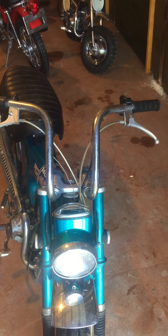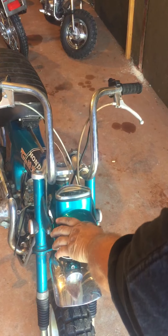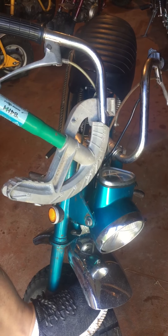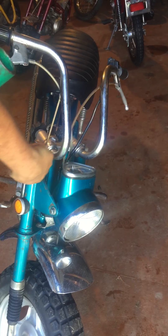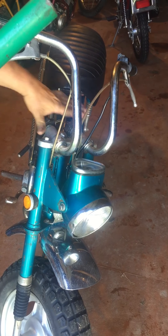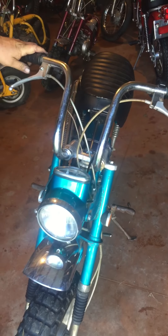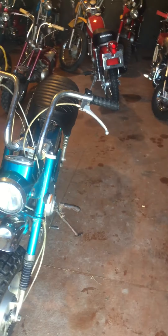Okay, that was a perfect bend — right out where it needs to be. I think I can go a little bit more, keep tweaking. This one looks like it needs to be turned out a little bit too, so we're gonna try this one — take it out just a hair. Put your foot on the tire like this and make short, quick strokes. You don't want to do this on a '68 because the plate on a '68 Z50 down here is not reinforced and you'll crack or break it. Make sure it's good and tight and not loose. Now look at the handlebars — they're a lot straighter.